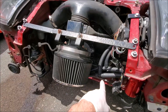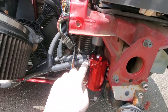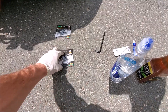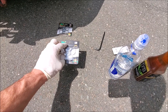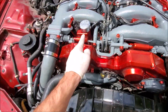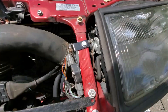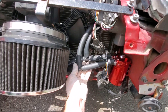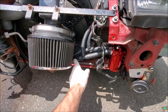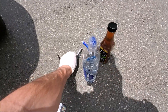I went out and got some 5/8 heater hose to match up with the nipples on the oil catch can and the nipples coming off the intake valve covers. For this kit, you're going to need clamps — I only used six: one here, one here, one on your intake piping, another on your intake piping, and one for each T-fitting. You'll also need two 5/8 plastic T-fittings.